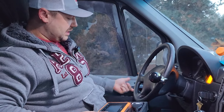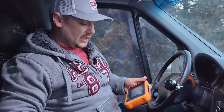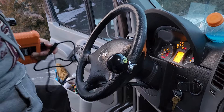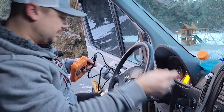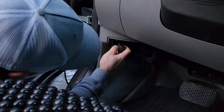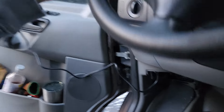It just goes to your OBD2 right here on the left-hand side on the bottom. We'll plug it in real quick and we'll do a quick scan and do a quick look-see at what's going on. What you want to do is accessory on. Do not start your vehicle, but accessory stays on and your stuff is right over here. You just go and plug into here, plug it like that, and get back inside.